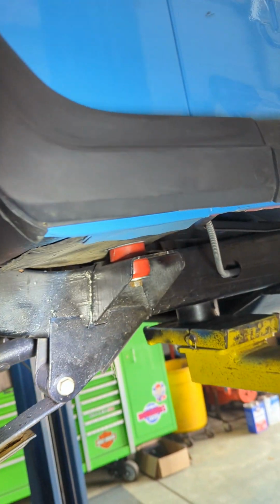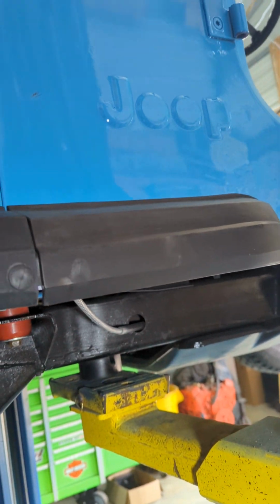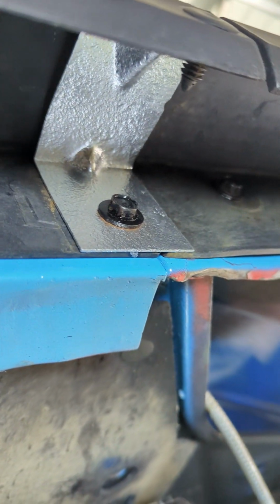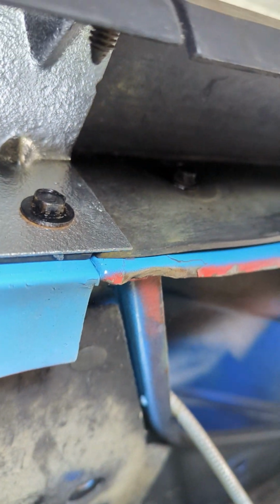In the back here, this is your standard flare extension. So it's the short one. This gets held in by 2 bolts. And then where the 2 flare pieces come together, there's a metal plate. And it uses a push pin on the outside. They just fit how they fit. I tried moving them around and everything else. They just fit how they fit. You're dealing with old rubber that has probably shrunk a little bit over time.